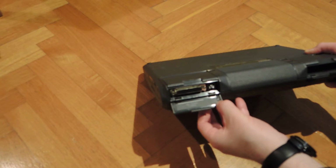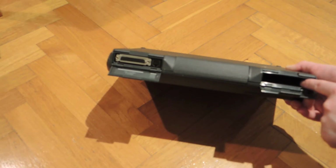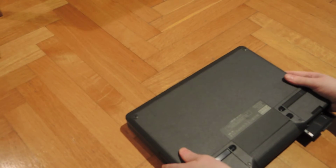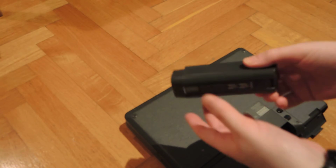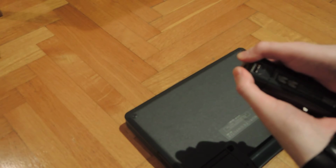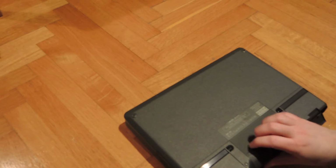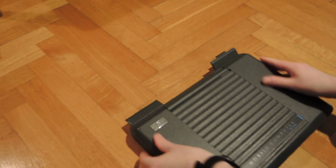This is a serial port, which is RS-232, but the connector isn't very common for that at all, while this is a hole for add-on modules, like the one that acts like a sound card to make that record button we saw before useful for something, while this contains batteries. Now, by removing them, I will erase the memory contents. You see, lots of batteries here, and if I had, which I don't, the version of this which is actually a solid battery, it would have more contacts to also be able to be charged by the computer itself. I don't remember if I even have a power supply for this, but anyway, I use it from batteries when I want to.